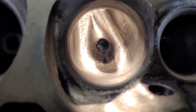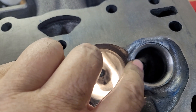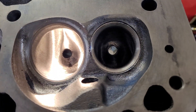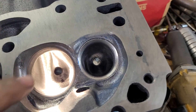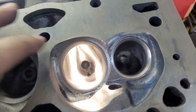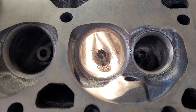There was a decent amount of sharp edges around the port that need to be worked on. I did a little work on the chamber — notice the stock shape versus what it looks like now. I definitely have to make the last cut bigger on both sides, a little bit of de-shrouding, not a lot. I haven't flowed it with the chamber exactly the way it is right now.